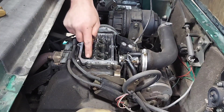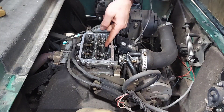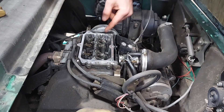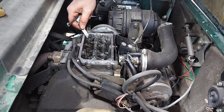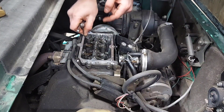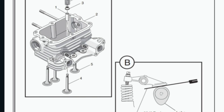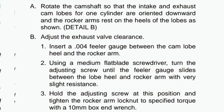So then you're going to want to just keep doing that — do that on the next two and you're all set. In case you're wondering why I'm checking it here, that's what the service manual states. You can also check it here like you traditionally would, there's just not as much room. If you get four thousandths here you should get four thousandths there — it's usually identical. Just repeat those steps on the next cylinder, rotate it by hand a few rotations, check them all again one more time, put your valve cover back on and you're good to go. I'll leave a couple screenshots of the service manual right here.